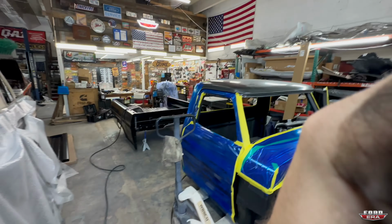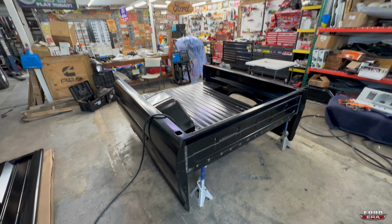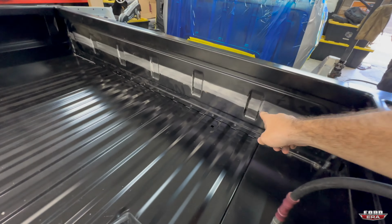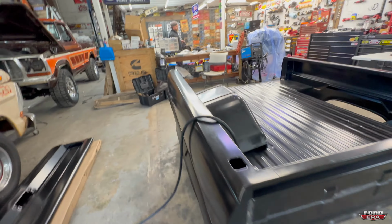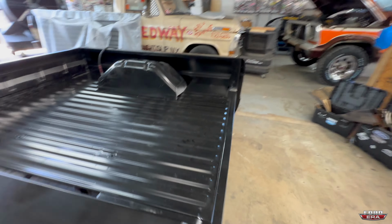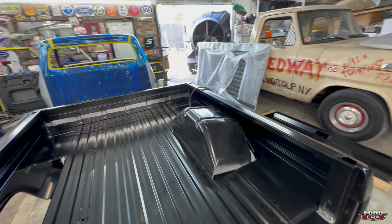So it's the next day, day two for Cody, and he got so much stuff done yesterday. I was running around making the other video that you guys saw when I was delivering some trucks up to my other place, but he basically got the bed fully finished. It's got a 6-inch drop, so he took 6 inches out of the header panel, fully smoothed that out. Everything is TIG welded, smooth. Then he cut the side panels, raised those 6 inches, mounted it all back together, and now this is a carbon tub. He is widening and doing all that stuff.